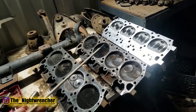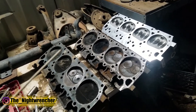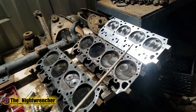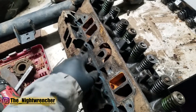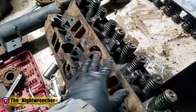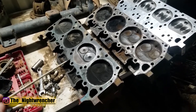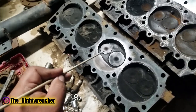What I've got here is stage one of upgrading the Mopar 361 by installing a set of later model 440 or 440 source heads. The designation on the stock Mopar heads is 924 for the 361 and 452 for the 440 heads, but I'm going to call them 361 head and 440 head just for simplicity.